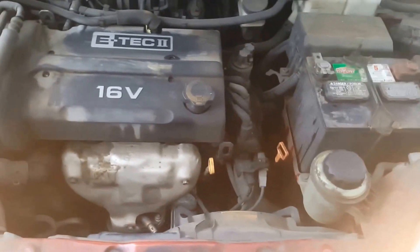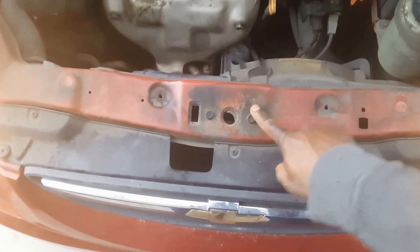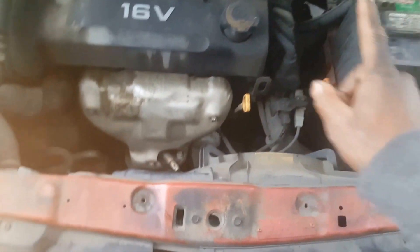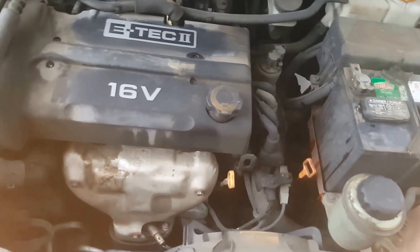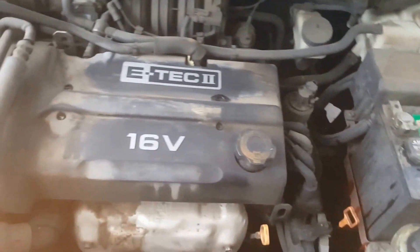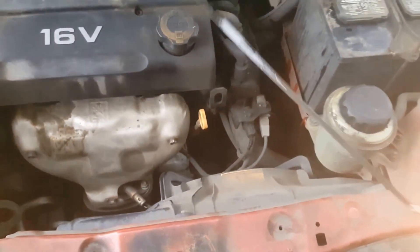This car is pretty dirty but eventually you can clean it up — get some Purple Power and a scrub brush, spray and scrub it, then pressure wash and do it again. Once you clean your hoses off with the brake cleaner and you're low on ATF — I wasn't low but you could be — take some of your old ATF and put it back in there. Do not go and get Dextron 3, Dextron 4, or Dextron 6 — I know it's a Chevy but it doesn't take that, so do not put it in there, it's just too risky.